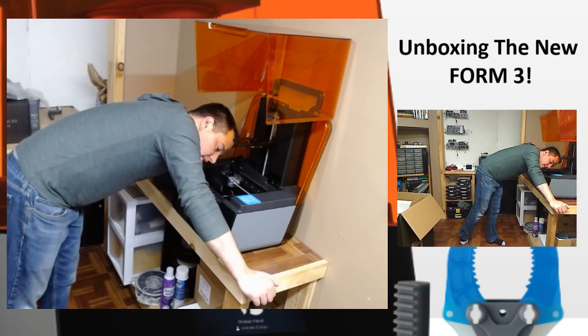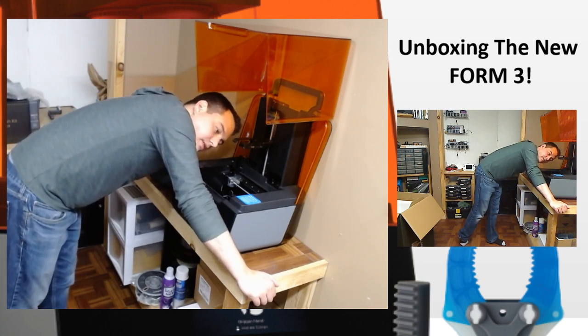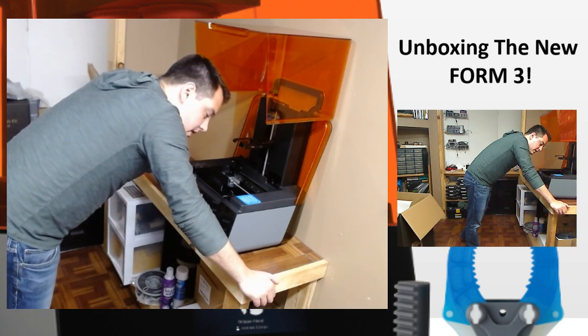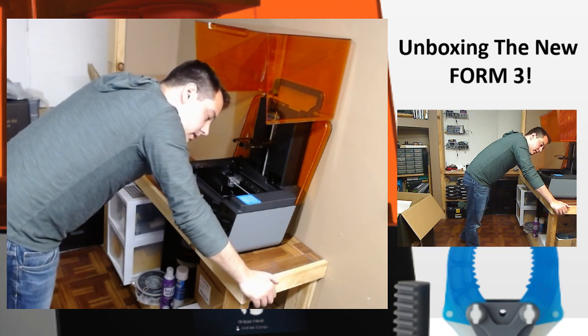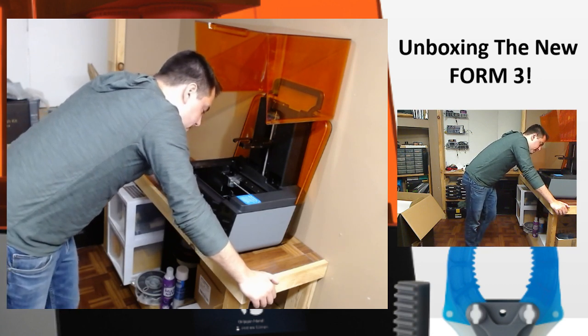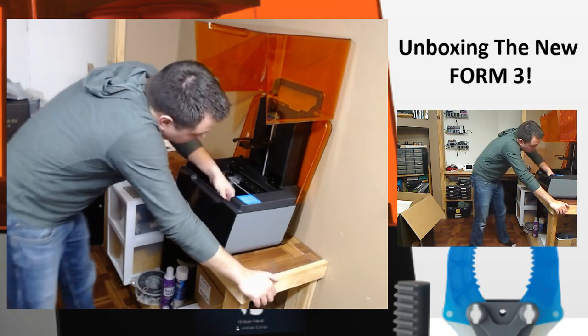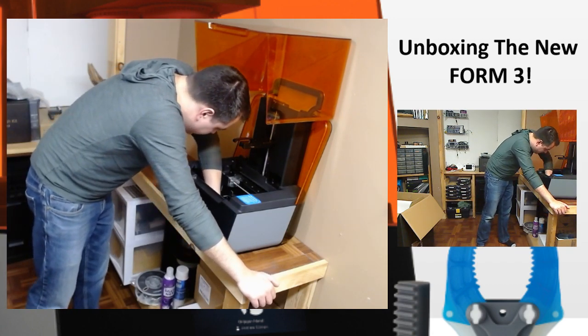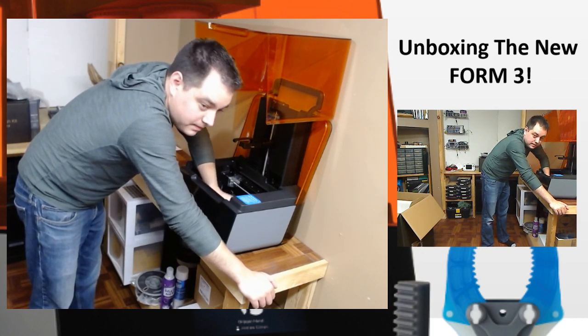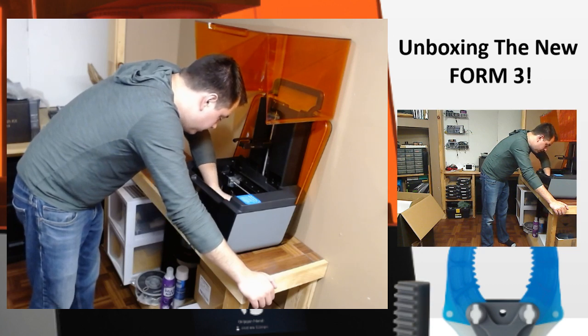Okay. Alright, so that's that little latch they were talking about. So, gosh, disconnect power, locate the latch on the LPU housing, loosen A, and remove B. Thumb screws and the LPU latch. Store the thumb screws and latch with the original packaging. The LPU must be secured with the thumb screws and latch during any printer transportation. Alright, so it's just these two little thumb screws down here. I guess the LPU is what I was saying is the housing for the lasers.